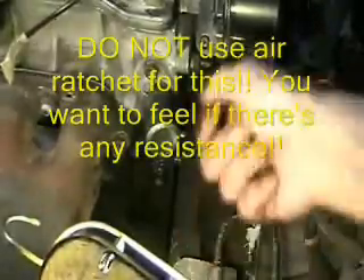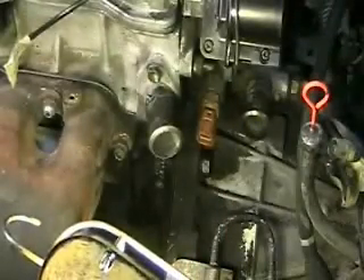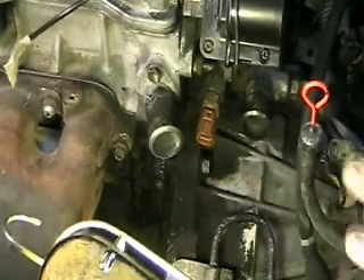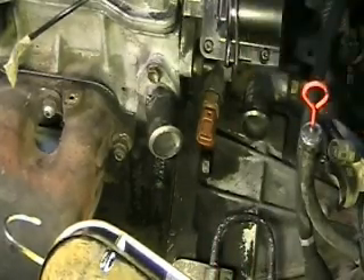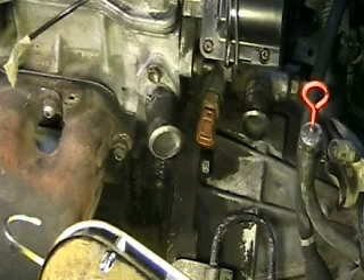Let's go ahead and bring this up and see if it draws in. You can see it's finally starting to draw in. It's just about closed up, but I'm not going to close it all the way just yet. I'm going to get all my other engine-to-transmission bolts started, get my starter bolt started, and once all the bolts are in then I'll go ahead and lock it up closed. I might need just a little bit of play to finish this up, so I'm going to go ahead and get that sealed up.